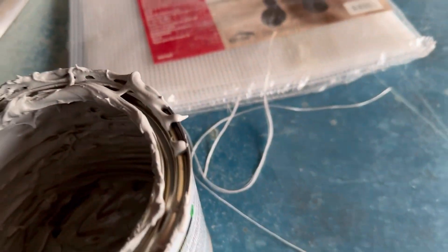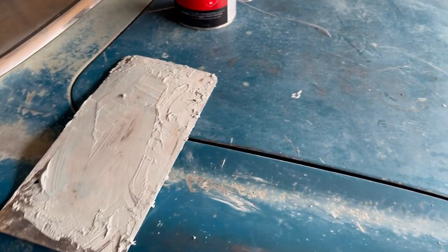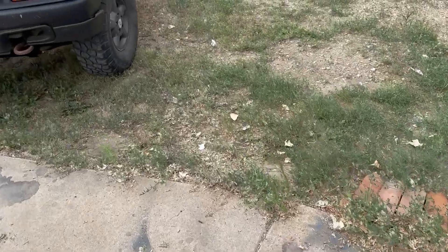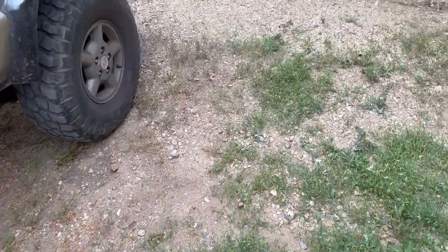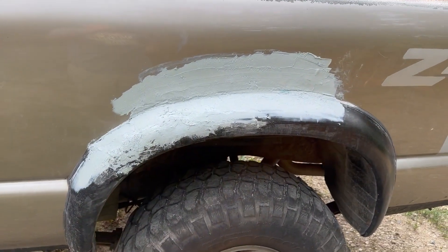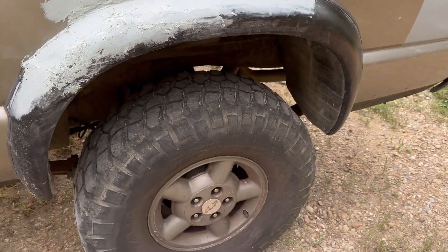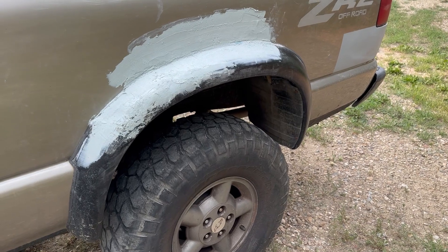What I like to do is use an old license plate to mix the bondo up and then just throw it away. I've already put that much on this pickup. I mix it — I never stir it — I mix it flat, which is supposed to be better for it and means less bubbles. I use a couple of these, then just throw everything away. I have a lot of license plates because I have a lot of junk cars. A couple coats in the front. I did a lot of sanding, but I'll just sand that smooth and rhino line that fender well — that'll look great. You have to turn into an artist back here because you've got to do a lot of sculpting. Sand, sand, sand, sand — then fill, fill, fill, fill. This doesn't have to be perfect.